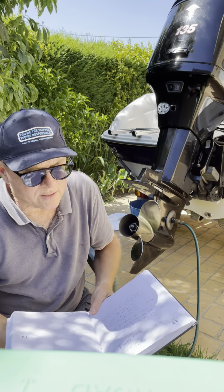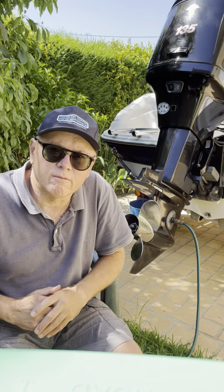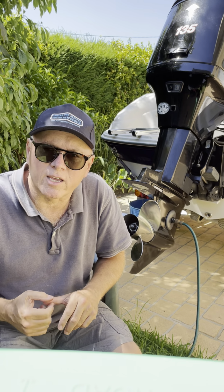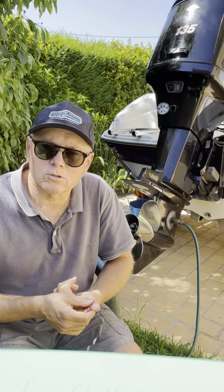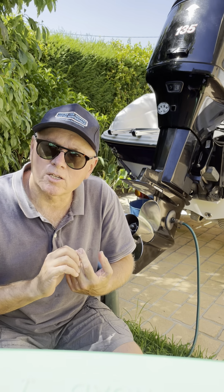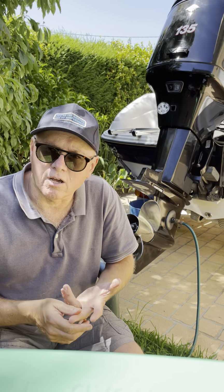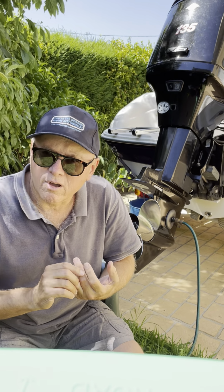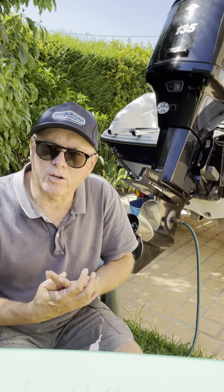Next one, batteries. Now, these engines are very high demand on batteries. They use the battery to run the starter crank, of course, all the electronics, and the crank has also got to run the air compressor and compress up to 90 psi. It's also got a number of fuel pumps, one of which is electric. So there's a lot of electrical demand on these engines.